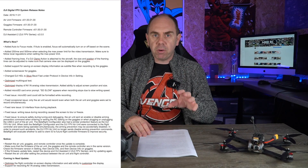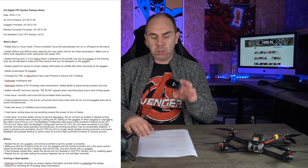The new firmware version is 01.00.01.00 and that is an update for all parts of the DJI digital FPV system. You do need to make sure that you update all parts when you do this firmware, and you need to do that via the assistant for PC or Mac. Once you've done that you will have all of the new features that we're going to discuss available.